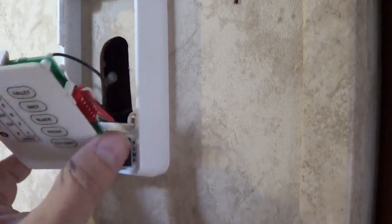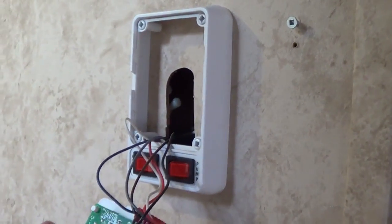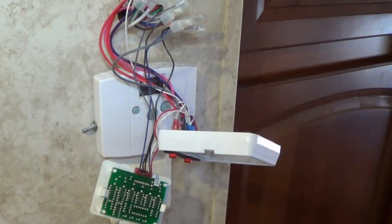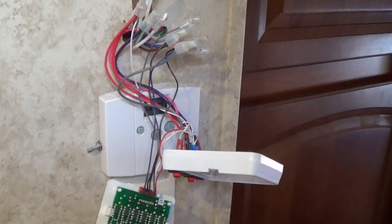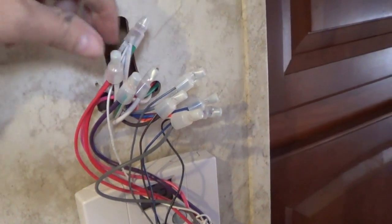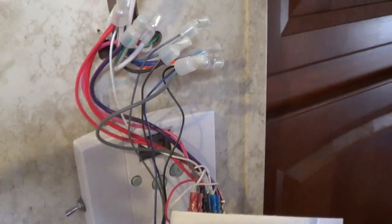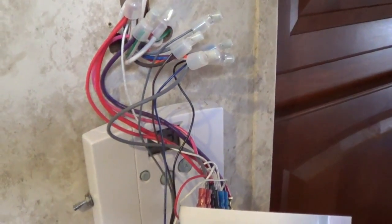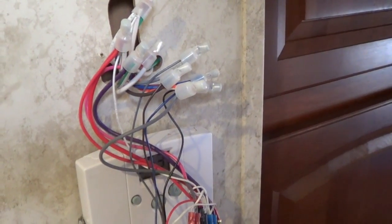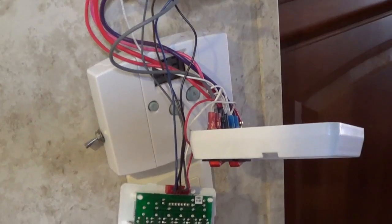This little panel opens up — there's some of the wiring. I'll get the screws out and pull it right off. Oh my god. Well, at this point if I didn't have 30 years of electronics repair experience I'd be a little scared right now. Check that mess out. I'm going to have to go through and figure out what all this is. The problem with RVs is they change the wire color codes. Normally in automotive 12-volt wiring your red is positive and your blacks are ground, but in most RV wiring they copy house AC wiring — blacks are positive and whites are ground or negative. The problem is they start interchanging the two and it can be confusing.